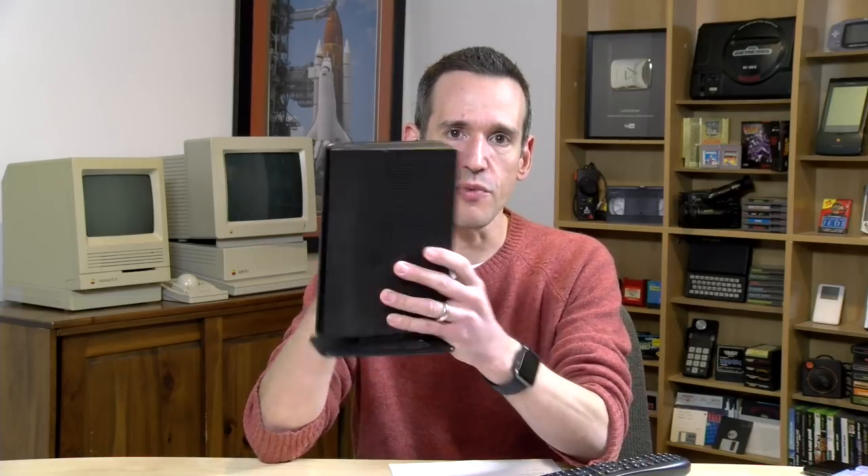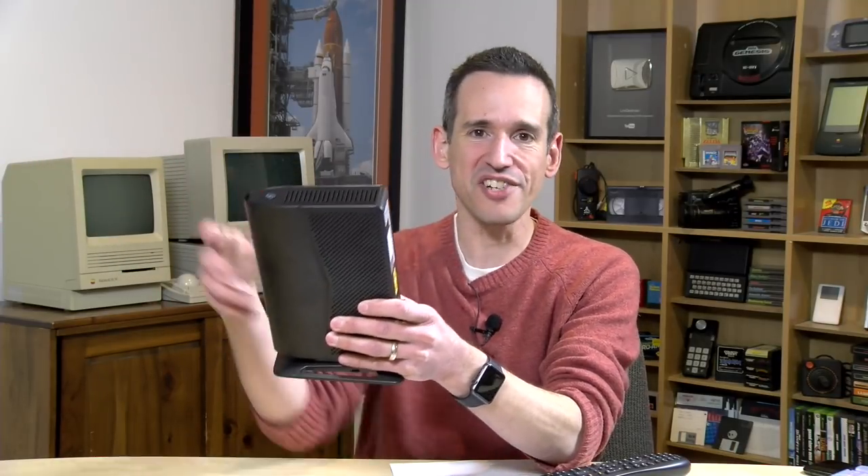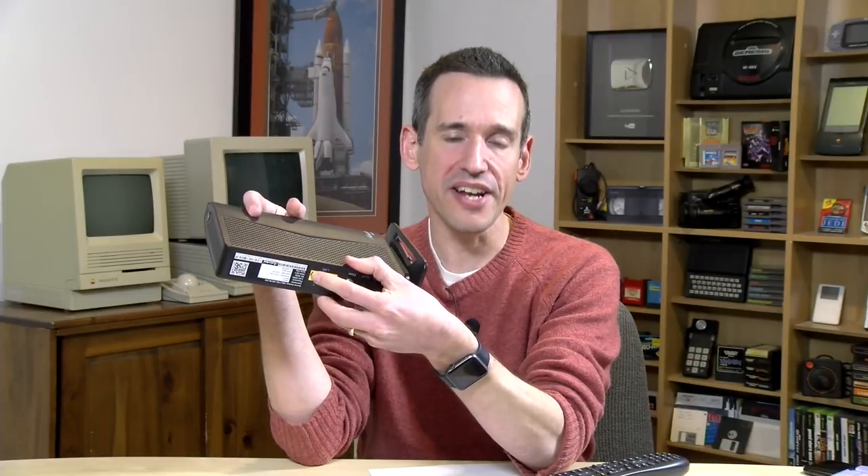Action Tech also has this device which is a Wi-Fi access point. You plug your coax cable into the back, it sees the other MoCA devices on your network, gets connected to the internet, and provides Wi-Fi to devices in the far reaches of your home — but it also adds two wired connections as well. So if you had a computer and an Xbox in that room you could plug them in directly and also provide wireless to that portion of the house. I've covered more detail on this in other videos, which I'll link to in the playlist in the video description.